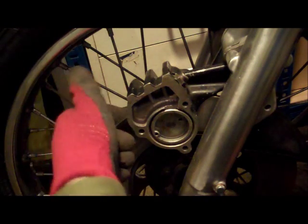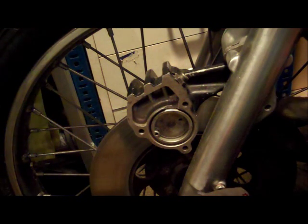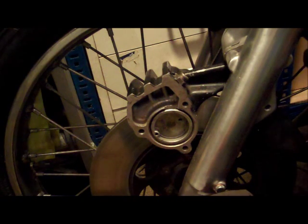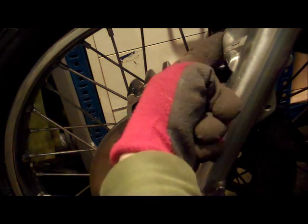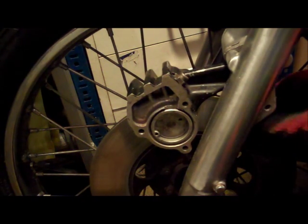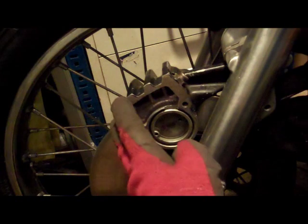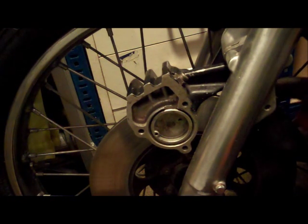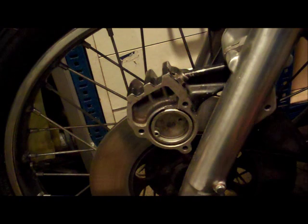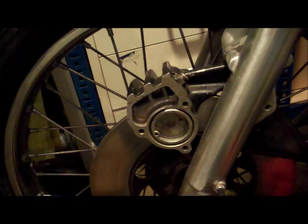Inside here we've got one of the brake pads, the disc, and the other brake pad behind. To actually remove the whole caliper unit we've got to get to these screws - you can see one here and one just here. The two inner ones on the inside actually hold the mudguard in place, and this one holds the shield on the disc. So to get these off we've got to get inside and undo these three bolts. Let's get to the bench and have a look at all the bits I've taken out.